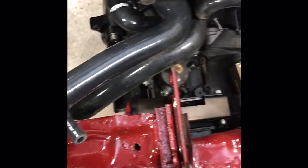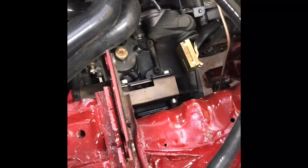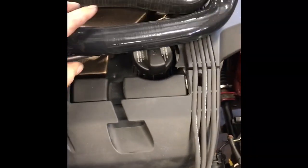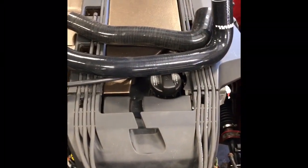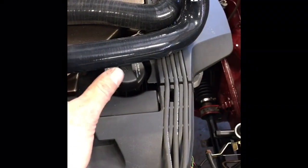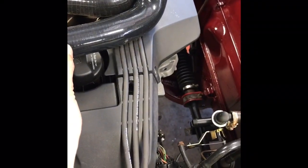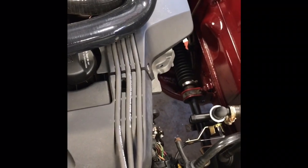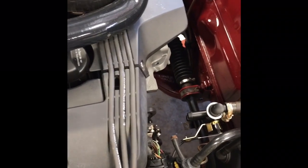I'm going to trim this upper hose. For the lower hose, I'm actually using one of mine because it's already shortened, but you can shorten your lower hose. Look up a Gates power clamp — you can cut your hose down, put in an aluminum splice, then use two Gates power grip clamps which are heat shrink, and then you've got a permanent hose.